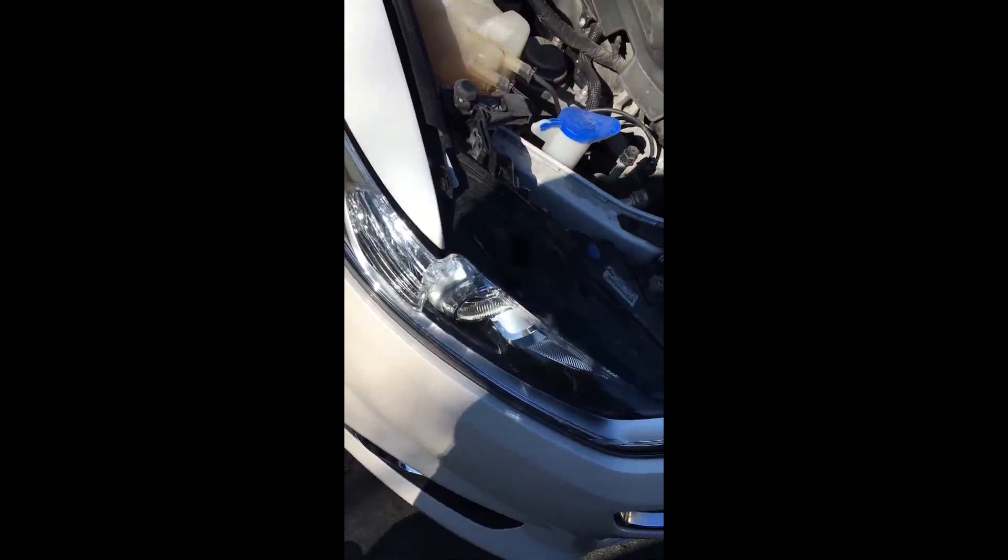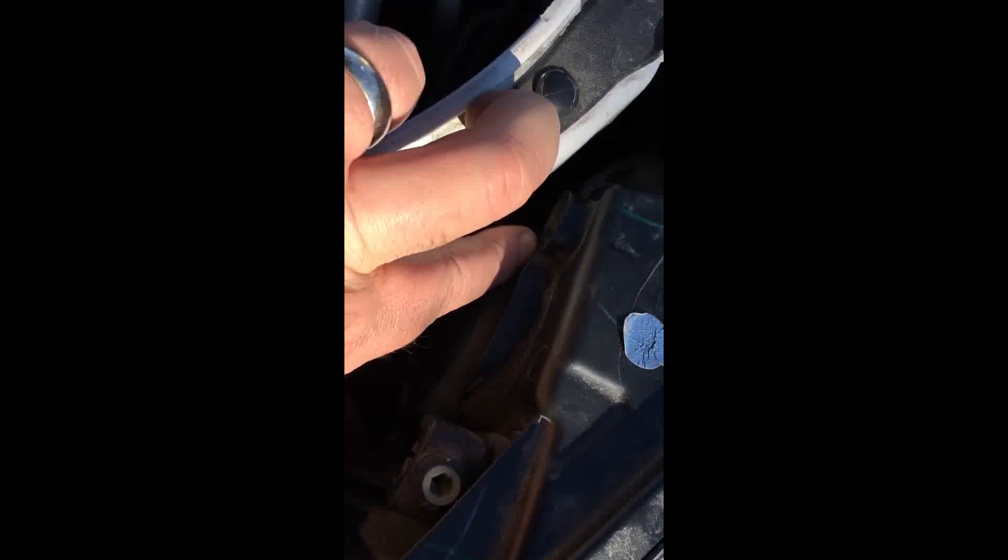On the other side, there's the bulb. You can see the LED I just replaced in there. If you hit the lock button, it's one of the bulbs that comes on closest to the grill — that's the LED I just replaced. The way you do it: there's a round rubber seal that you pull off. You reach up towards the grill, pull it out, and replace the bulb.